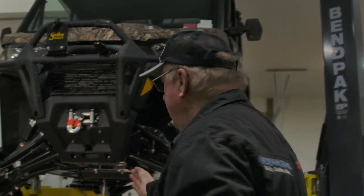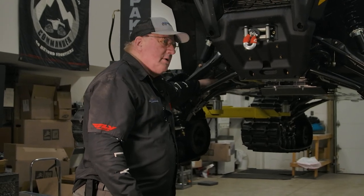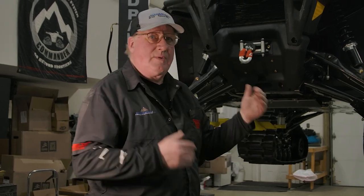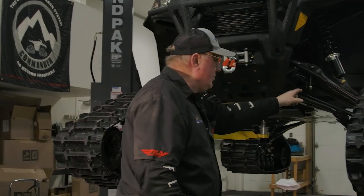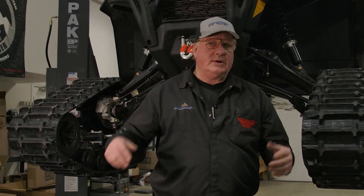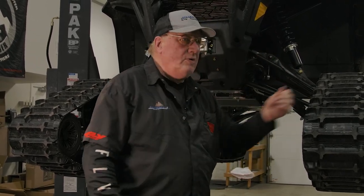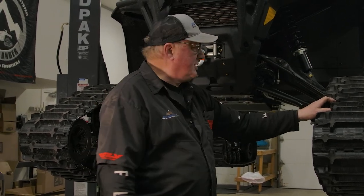You've got your tie rod ends here that you can adjust. The secret to adjusting them — after you decide which one to adjust — is you need to lock the steering wheel. If you turn the tie rod bar, the track won't move, the steering wheel just turns. So when you get the toe alignment just right, your steering wheel needs to be perfectly straight and locked down so it doesn't move. We'll show you how we did it inside. This is very important — you usually have to do it once a year.